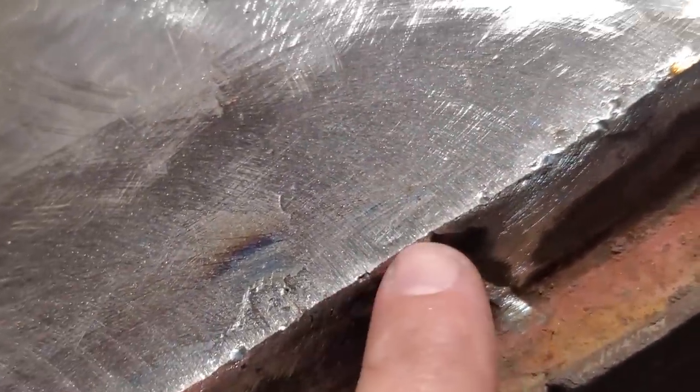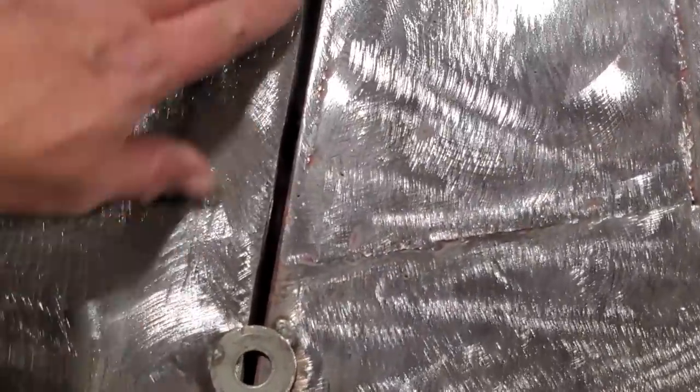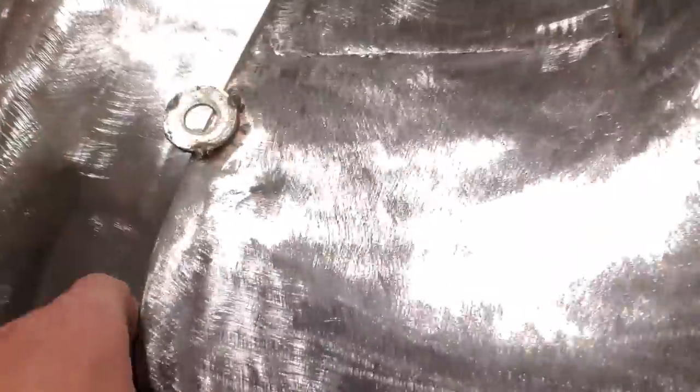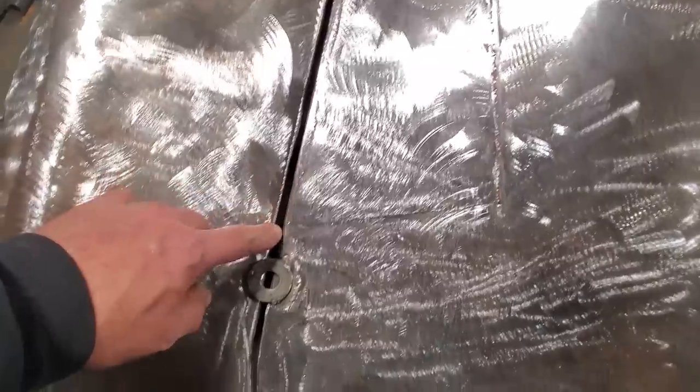All I'm worried about is getting a nice edge like this all down through here, and then I'll roll it off. So I'll get that welded up now and grind down. So I've got it all ground flat here, and I've got it flat on the inside as well. Got to grind it this way, and I've got to grind this way. Now that I've got a nice edge and I've welded along there again, I'm going to turn around and come in now, roll this edge off, so I get a nice seam like the rest of it up here, nice rollover. It's gone sharp here, and it rolls over here, and it's sharp through here. So I'll roll it off there now. There it is, all rolled off. Nice seam down through there now.